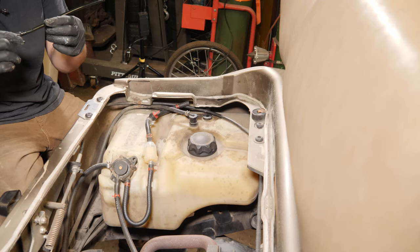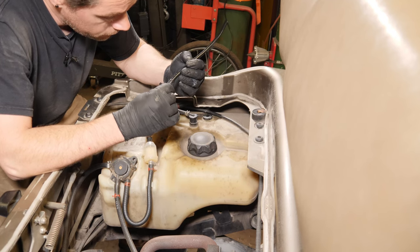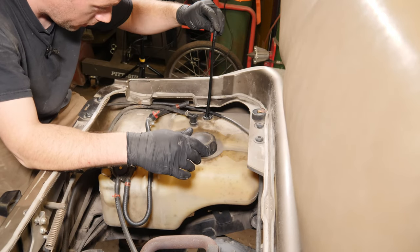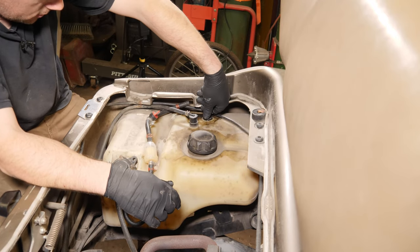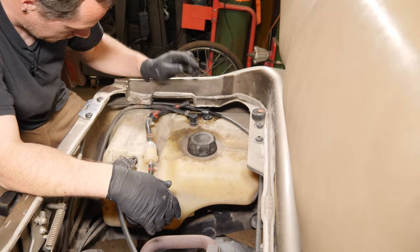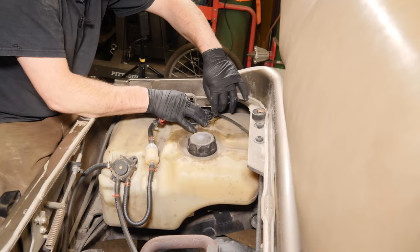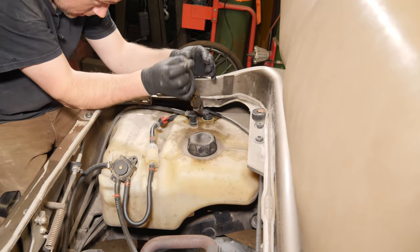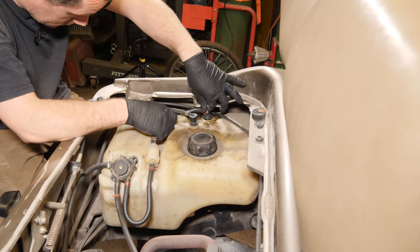This rubber piece still has a little tiny rip in it, but it's not bad. If it was ripped past the point where it makes contact with the tank I'd say let's change it, but it's down below. You put the grommet in first, get it nice and flush. It peed a little fuel out — that tells me this is a rollover vent for the tank, which is supposed to stop fuel from leaking out if you ever roll the cart. The gas cap is a sealed system so the tank needs this vent. Problem number one is fixed.